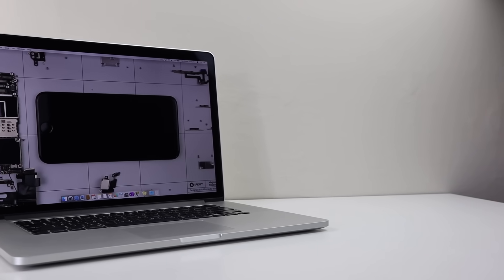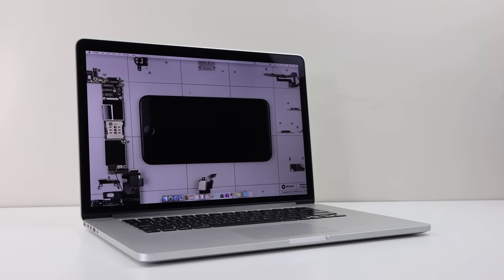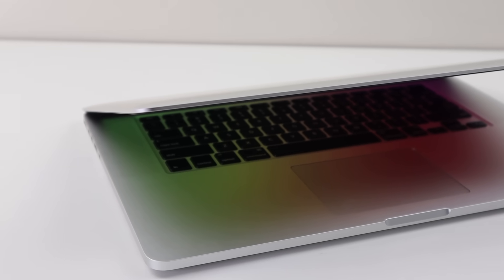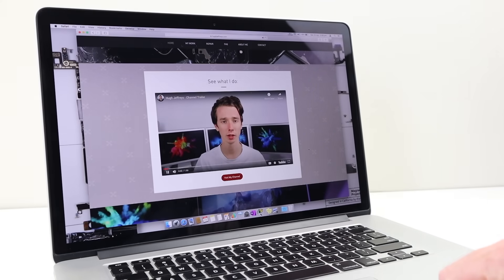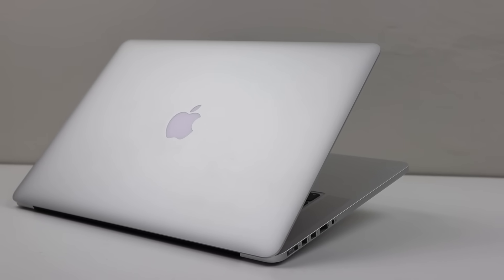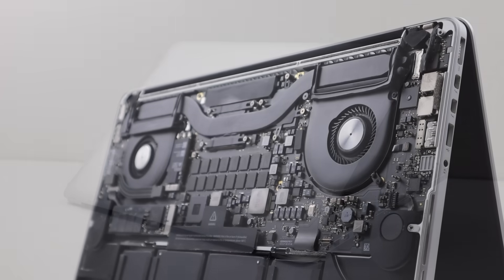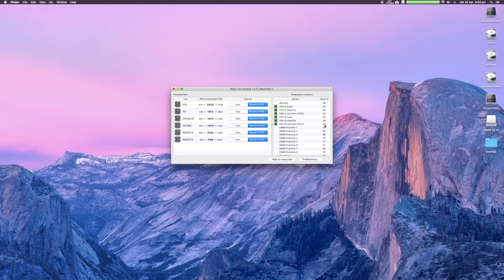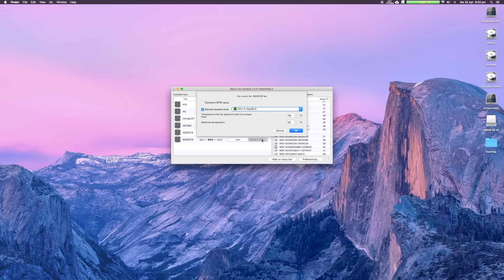For those wondering, this is a late 2013 MacBook Pro with a 2.3GHz i7, 16GB of RAM and a GeForce GT750 graphics card. And yes, even with that fried capacitor on the audio amp, the sound is still working. I would recommend to anyone with a laptop that's running hot or is older than five years to open it up, clean it, and apply some new thermal paste, as I've just done to mine. Otherwise, you run the risk of damaging your device if it becomes too hot and cannot properly dissipate heat due to dust building up inside. If you're looking for a way to control your Mac's fans and set their speed based on temperature, you can use a program called Mac Fan Control, which I'll leave linked below. I'd recommend this to anyone with an Apple computer, because if configured well, it can keep your computer much cooler.